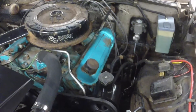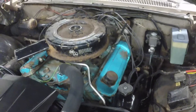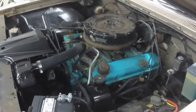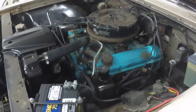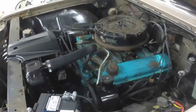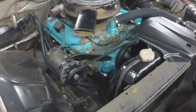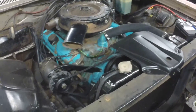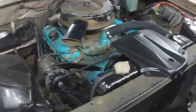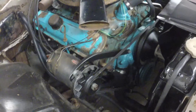I'm going to keep the generator — and another thing: I have a voltmeter in my '59 Chevy under the dash, and voltmeters aren't really as telling as an ammeter about what your charging system is doing. As amperage decreases, voltage increases. When you start the car your voltmeter might read around 12.6–12.8 volts because the high amperage output lowers the voltage. As the generator charges the battery back up, the amperage decreases and the voltage rises, running close to 14 volts when the battery is charged. That's why I'm keeping the generator — I want to keep the car original.